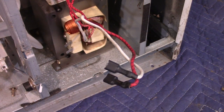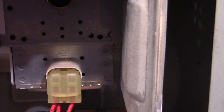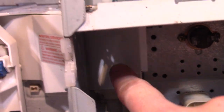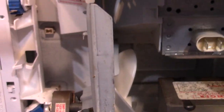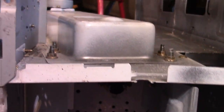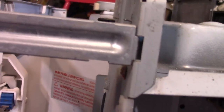Let's take a look at the magnetron over here. It's kind of hard to see, but there's our magnetron. You can see the high voltage connector going to it right there. It looks like this actually has a duct here that goes into the side of the microwave. This fan blows into this area and through the magnetron, and then the heated air goes into the actual microwave space.